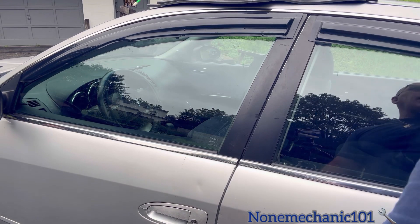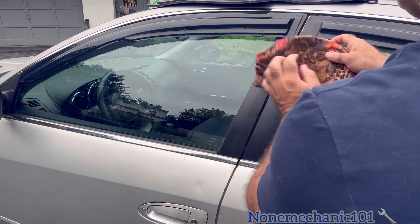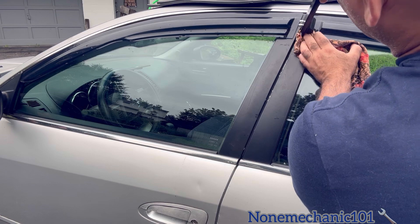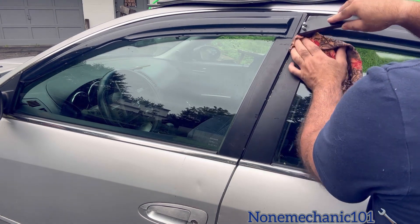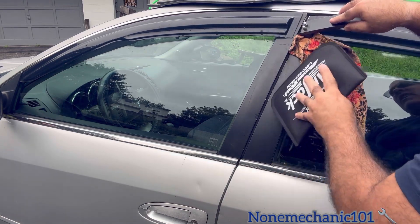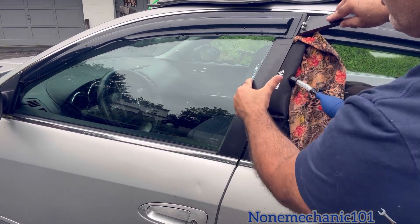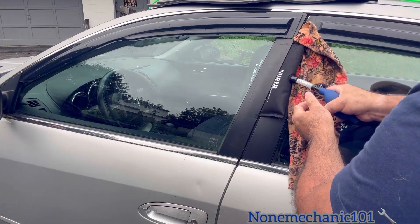So our door is locked. We're going to use this so we don't scratch the car, and we're going to use the end of the one hand jack — this is just to help out the air jack. You push it back, take the air jack, push it in, make sure it goes in. You see it? Remove this and start inflating it.